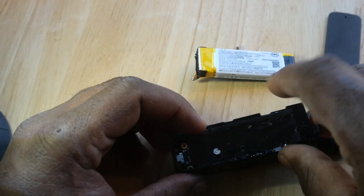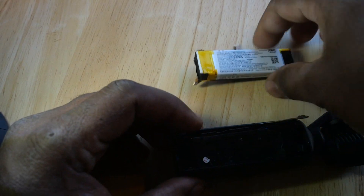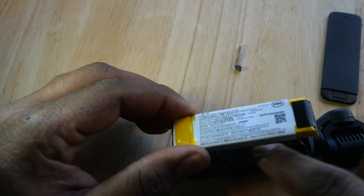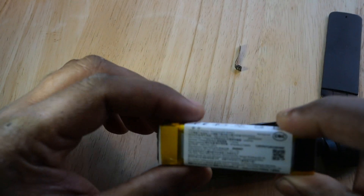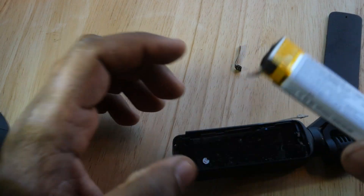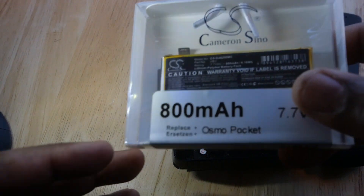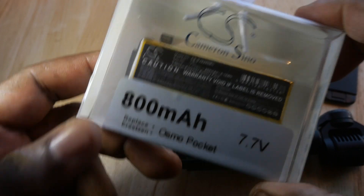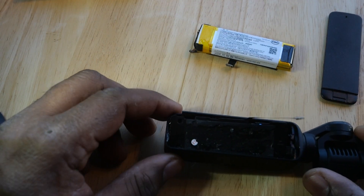There is a felt pad on top of this, and it's also over here on the battery. That felt pad forms a thermal break between the heat spreader plate and the battery itself. The battery is an 875 mAh battery at 7.7 volts. This damaged one I'm going to replace with one I bought online — it's 800 mAh. That's okay because I intend to power this camera using direct USB power.